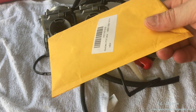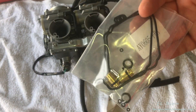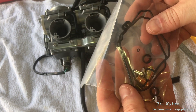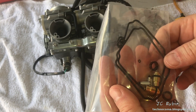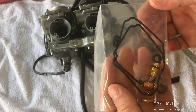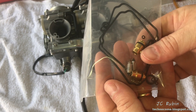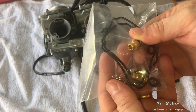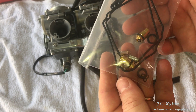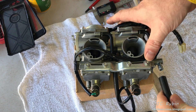Also not required but recommended: at least one rebuild kit. If you've got this bike, here's a rebuild kit — why would you not want to have one of these laying around? A very good portion of what's in this kit directly relates to the problems we're about to face: the covers we'll take on and off, the seats for the floats, the float needles. So have a kit like this laying around. First order of business — I'm going to stick the hose on the end of where the fuel line would go onto these carburetors.